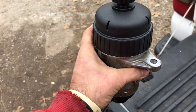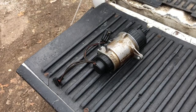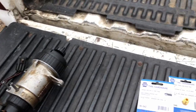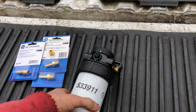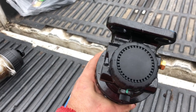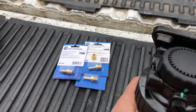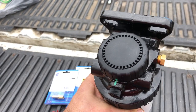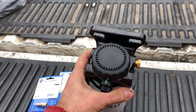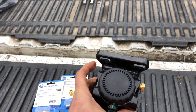So we're going to relocate that so that it's out of that valley. We can service it a little bit better and get rid of this fuel heater with this guy. We've got a nice little water drain here — two ins, two outs. We're going to plug up one of them and then use those hose barbs to plumb up the fuel lines. And should we want to add a heater again someday, it's got a nice little spot on top where we can add that.